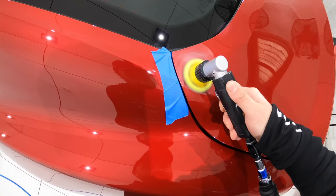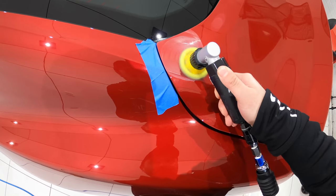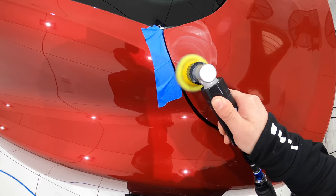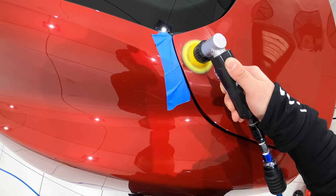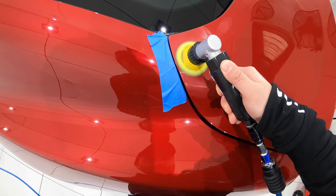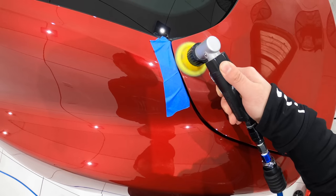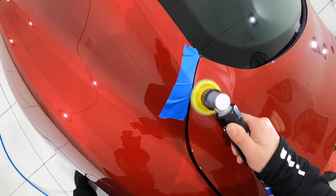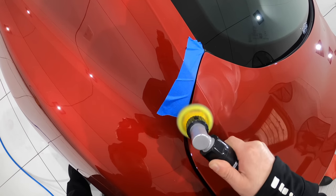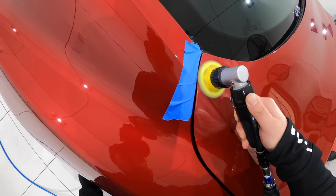Polishing a vehicle is nothing like waxing it. You really have to work that polish in, or else your results are simply going to be poor. And it's just an extraordinarily large amount of work to do by hand over an entire vehicle. Now, I know that for someone that has never used a machine polisher, it can be a scary experience as no one wants to ruin their car's paint. But if you can get over that hurdle, you will find that a free spinning dual action polisher, when used with finer polishes and non-aggressive pads such as this, is so much easier, just as safe, and gives you much better results in 1/10 of the time compared to doing it by hand.